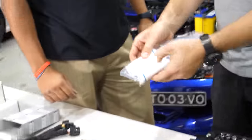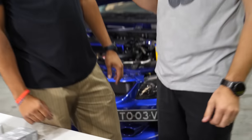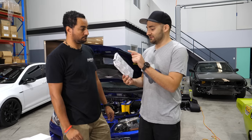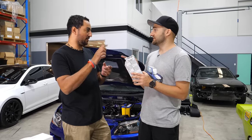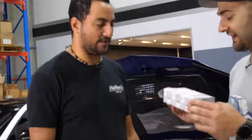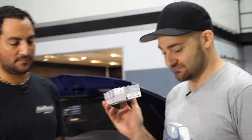We're changing some of these stalky stemmy things to make it fit properly, because these are 370Z coils. There's some conjecture about R35 coils. They look the same, but the part number is slightly different. The stem on it is a little bit longer because it's a completely different engine. Occasionally they're sold as R35 coils, but they're not. So you just have to make sure you get what you're after.